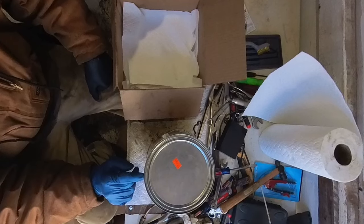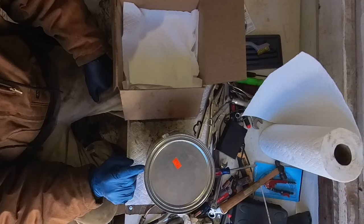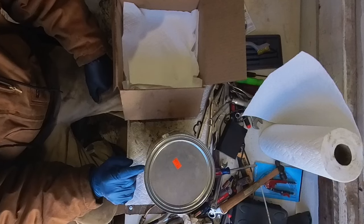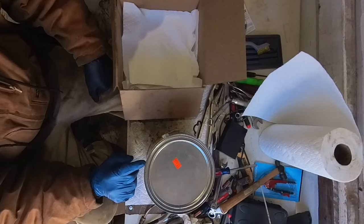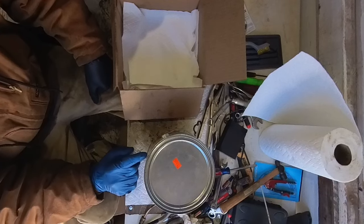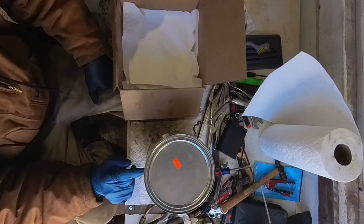Directions: disassemble carburetor or throttle body as necessary and place into included dip basket. Submerge basket in Chem-Dip and soak for 15 to 30 minutes. Remove parts and rinse with water. For considerable buildup, allow longer soak time. To remove extremely heavy carbon, allow to soak overnight. Rinse with water and clean with a wire brush if necessary. Do not soak coated or sensitive aluminum parts over 4 hours.